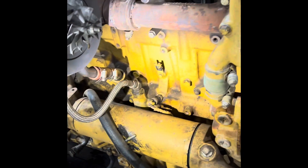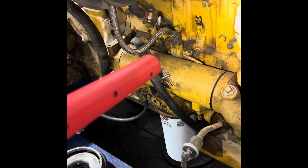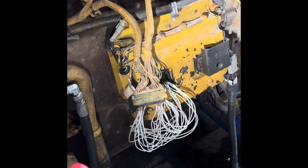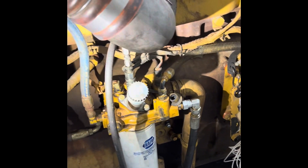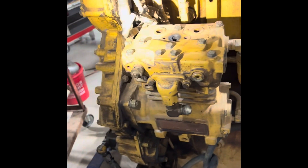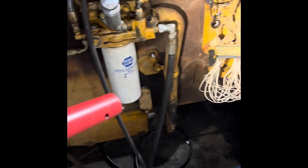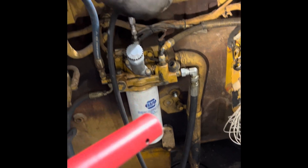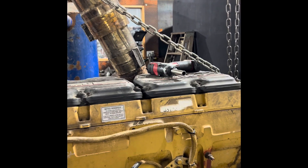Some of you were asking about the engine - it's actually a 2WS. Sneaking over here real quick, it's a 2WS with a BXS ECU just bungee-corded to it. The main reason is it's all I've got running right now - my MXS is over there with spun bearings. The MXS and BXS may not have compatible cam and crank sensors, so this might be the only way you can run one of these unless you actually have a BXS.